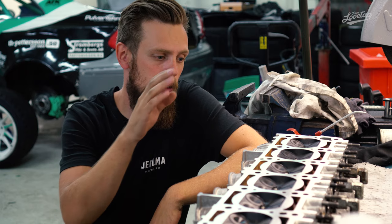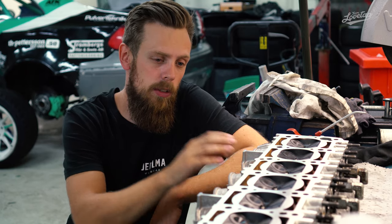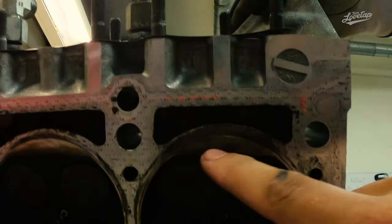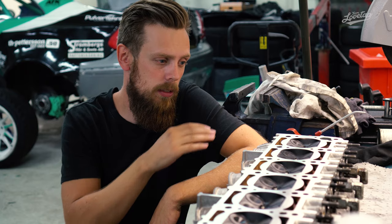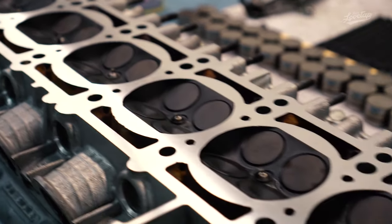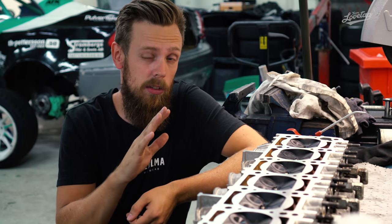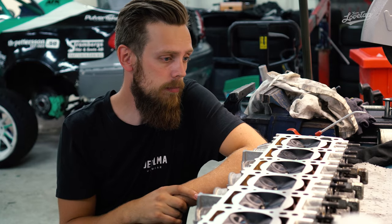After checking the surface of the cylinder head, we saw that the old OEM head gasket that we blew had left some marks on the surface of the cylinder head, so we decided on resurfacing it at the engine shop. We just got it back from them today. Today is Tuesday the 4th, and we're about 3 days out from when we're supposed to leave for the event.